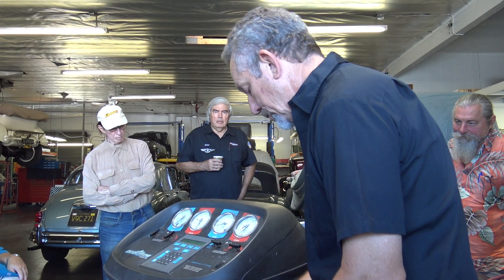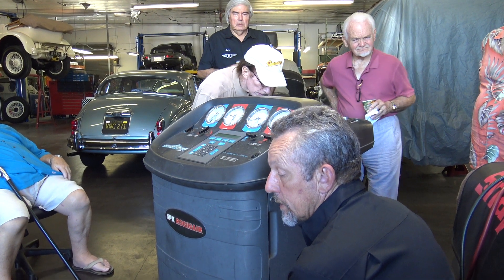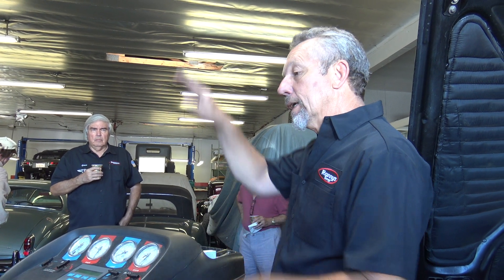There's also a machine called an identifier — mine is broken right now. It's usually a laptop-type thing; you hook it up to the system, it pulls a little bit of Freon out, and it tells you what the mix is. A perfect system has pure Freon in it. If somebody's added the wrong kind — people will put propane in — propane works great, but if you get in an accident it makes a big boom. The identifier will tell you the percentages of what kind of Freons and whatever else is in there.